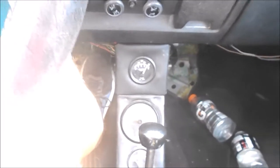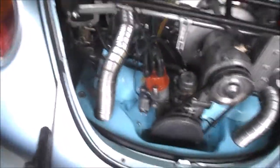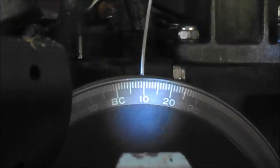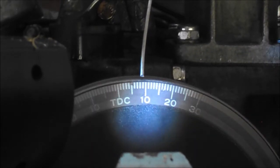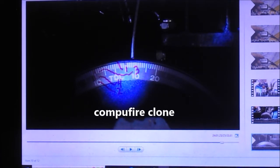I'm about two miles into my first little drive here — the thing's working just fantastic. That was about three miles. Let's go set up by the computer and check the video out. So I've scribbled a couple of marks up there on the screen, and the difference is about two degrees. My $30 CompuFire is more accurate than my old or new Pertronics, and that's pretty much what I thought would happen. So that's cool.